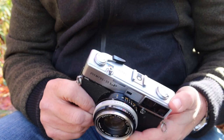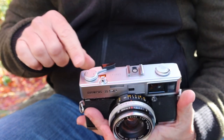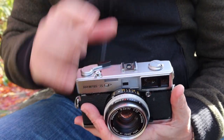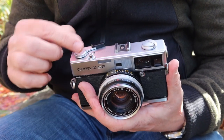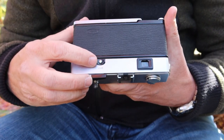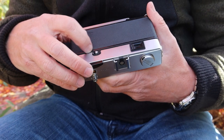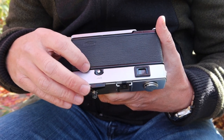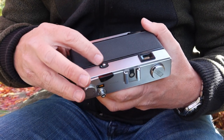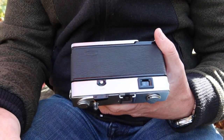Cleaning out the camera is not so difficult. There's no hardware around the outside to remove — just the rewind knob, the cap, and the shutter charging lever. Under those you'll find a couple of nuts; remove them and you can lift the top cover to access the inside. Make sure not to lose the shutter button as it can fall out when you remove the top cover. Also be careful of the plastic around the spot meter button, which often cracks — it's damaged on more than half the cameras I come across. You can usually glue it back, but make sure the button and plastic piece don't get lost.